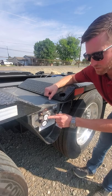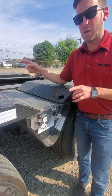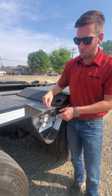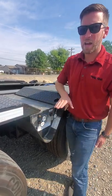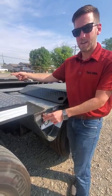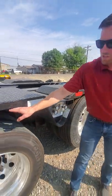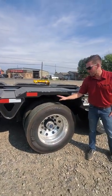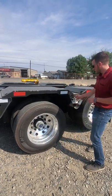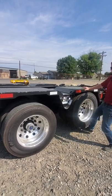Your lift axle is a simple push-pull button here — push this down and it's going to lower that axle. This trailer is set up with dual ride height valves. You have a primary on the driver's side second axle. When you're in transport with the lift axle down, that's going to set your ride height per the manufacturer setting. When you raise it, it's going to switch to your passenger side ride height valve, and that's going to raise the airbags just slightly — sitting about an inch and a half higher than normal conditions because it's not loaded and your lift axle is up.